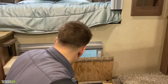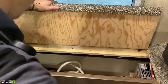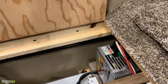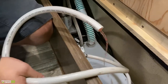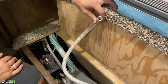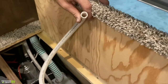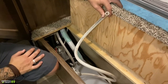If I go ahead and lift this compartment up here, we have a secondary storage area. Pulling that out exposes your water tank and your converter down here. If you lose 12-volt power when plugged in or your battery is not charging, keep in mind you do have a couple of fuses right there on the converter. The main reason I'm removing that is to show you this vacuum line here — there's a little bit of antifreeze still in the line. This is where we are going to introduce that inflow of antifreeze if we are doing a winterization process.